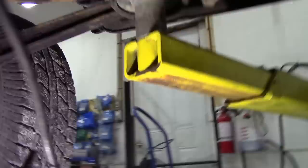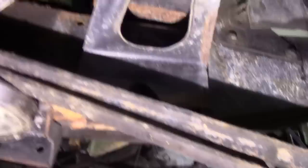This cross member is obviously covered with grease from a leaking transfer case — not a problem. The outriggers: somebody's made a nice job of these. It looks like they've cut the outrigger short and just welded it on, which is quite acceptable. But notice that the replacement outriggers have a big hole at the bottom — the originals were boxed in with just a tiny hole to let water out, which worked quite well.